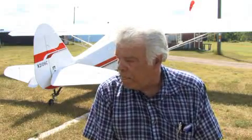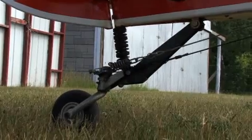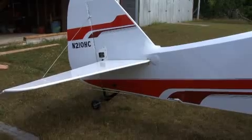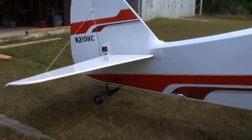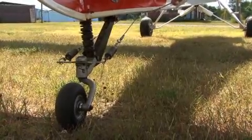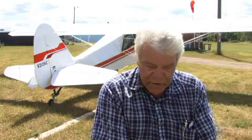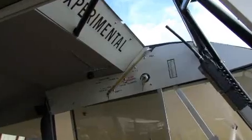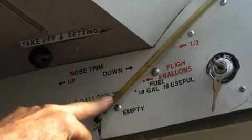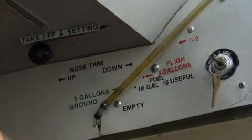The tail wheel on this airplane — that's a bogey wheel from a snowmobile. They're a whole lot cheaper because they're just laying around free. I didn't want to buy a tail wheel spring because that cost too much money, so we just ran a shaft up the post in the fuselage and put car valve springs on there, and it works pretty good. If you ever break the tail wheel off, it's flat under there like a skid, so if you have to get home, you've got a skid.